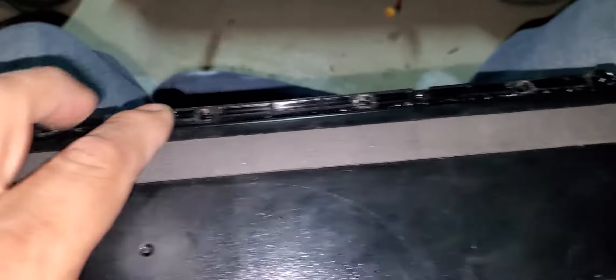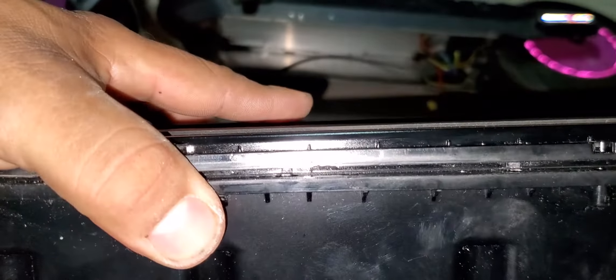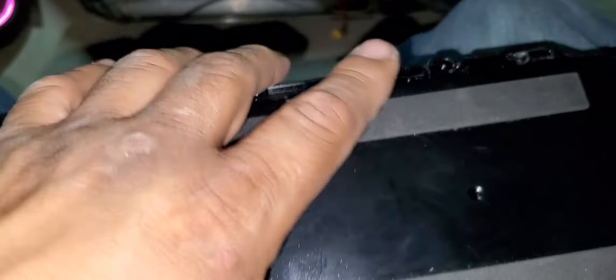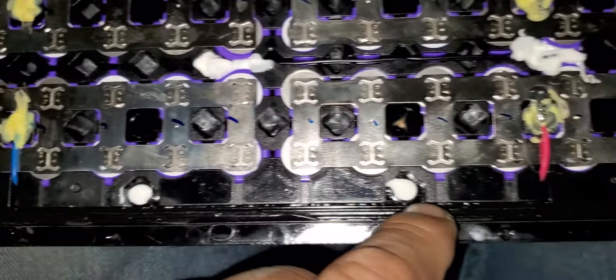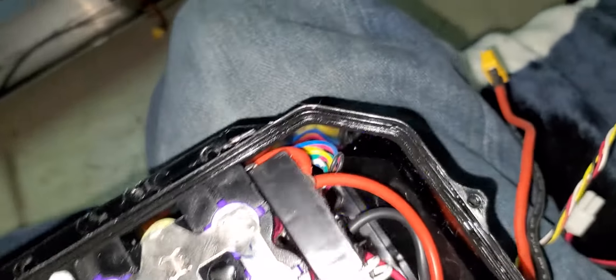What you're going to have to do is take off the nine screws that are on the side right here, and then with an exacto knife kind of take off the glue that's holding the cap in place and just pry it off a little bit with a chisel — whatever tool you have to pry off the cap. Once you do that, there's adhesive around the top part of the walls where the battery is sitting, so you need to use something to remove that adhesive or glue. Just be careful not to puncture the batteries.